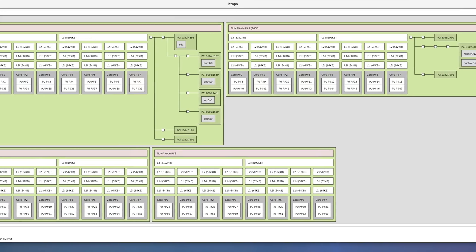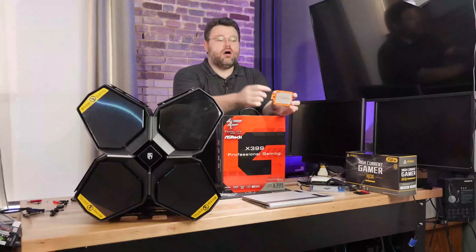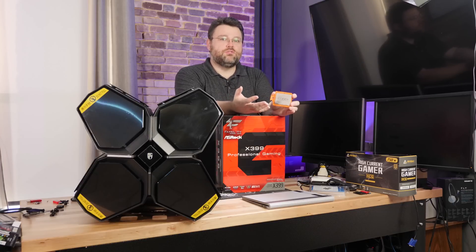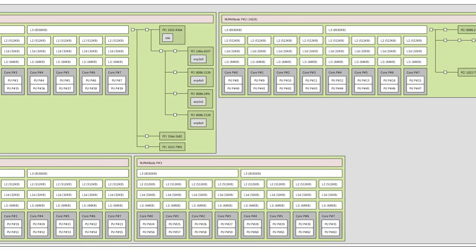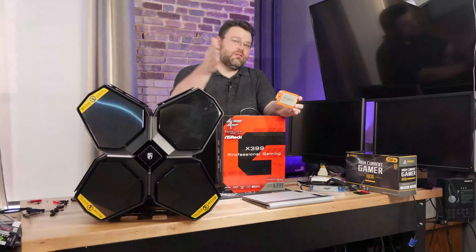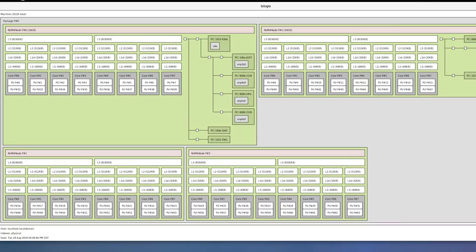Here's the output of 'lstopo' - list your CPU topography. This is a visualization of the physical topology of the CPU, and even if you don't use Linux this is a good idea to understand what you're up against. On Windows, on the 1950 and 2950, you can tell the CPU whether it should present itself to the OS as one unified CPU or two NUMA nodes. With the 2990, we've got four NUMA nodes - two of the NUMA nodes have 16 gigabytes of memory associated with them and also have the PCIe bus peripherals. That explains some performance weirdness on first-gen Threadripper.